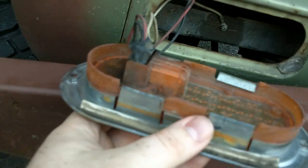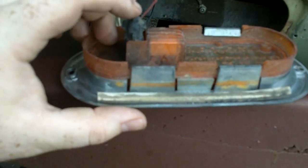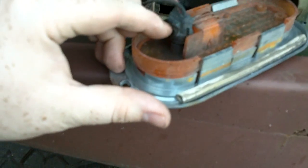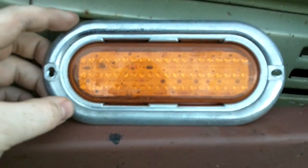The other thing, the Maxima, if you go with the mainline semi-truck factories, the Maxima brands are completely sealed, so you have a waterproof pigtail that you have to buy to attach to the light and go in there. Also did new grounds, and so you get front and turn. And these are the 60 LEDs, and again you can get the black rubber grommet ones. I like the snap-on ones because they fit just in that little hole a little bit more.